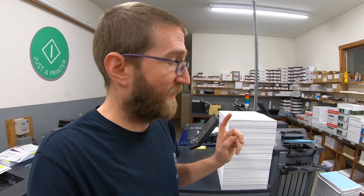This reminded me of a comment last week where someone said they were printing a job in their Fiery and it would just stop partway through — it would go through the job and at some point throw an error and stop printing. I was curious if anybody else had that problem, because I had the same issue — I'm pretty sure it was on the 1070, maybe another machine too — where if I printed a 100-page book face down it would print fine, but as soon as I changed it in the Fiery to print face up, it would partially print the job and then throw an error code. That's just crazy to me. If you have problems printing face up or face down, let me know.